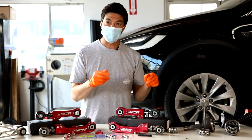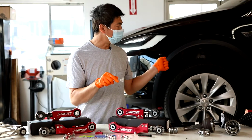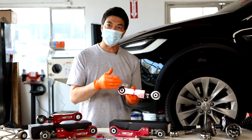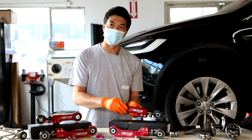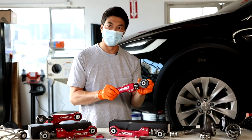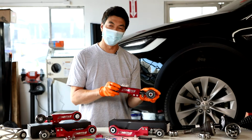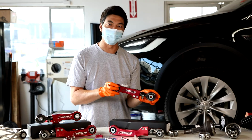As you're lowering the car to correct the driveline shudder, and you've corrected the camber, another problem that can be introduced is toe. The lower the car sits, the more the toe adjustment will drift out of spec. So by having N2itive's toe arms, you can also bring that back into spec, which is going to give you the proper alignment setup to be able to run lower without putting increased wear on your tires and to eliminate the shudder issue.